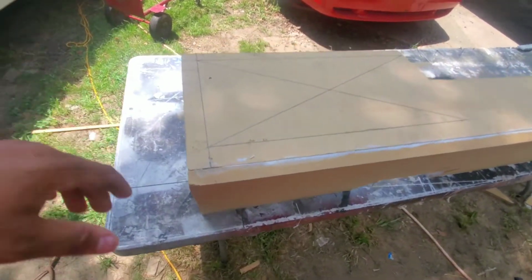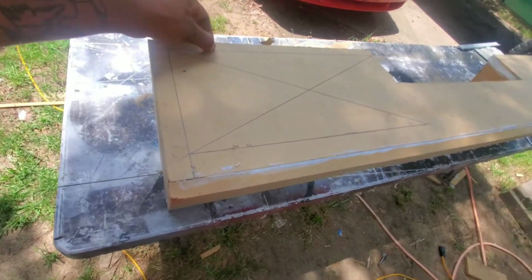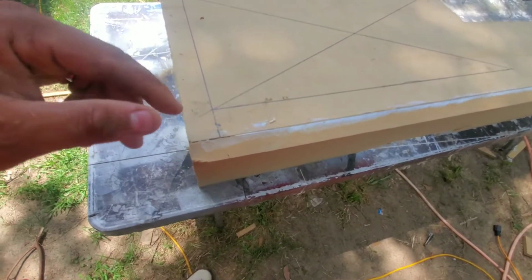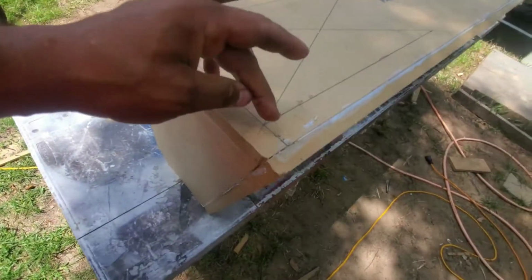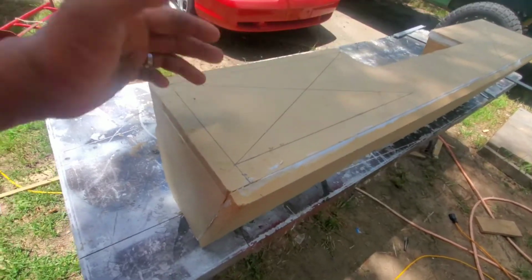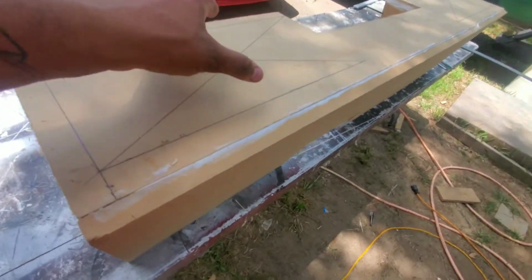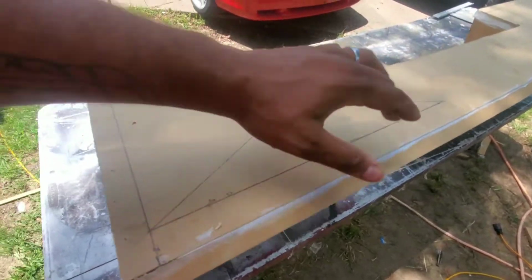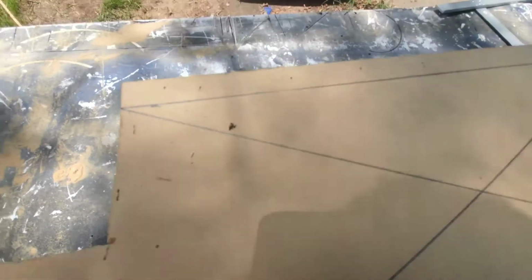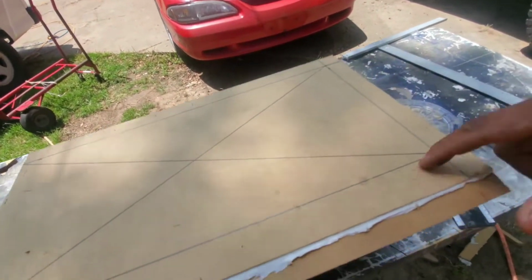All right guys, as you can see, I got it laid out now. How I got this, my material is 3/4 inch thick, so I just came up 1 inch from here and here. This 3/4 on top, so I'm not worried about it. And then I just measure it from here to here, 8 inches, because that's how big the sub is total. But we're only cutting a 7 7/16 hole. So that still gives us plenty of clearance all the way around this perimeter right there. Same thing on this side, spider. Look at the little guy. Anyway, he dead now. So that's how I got that.